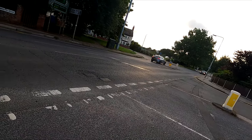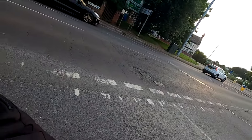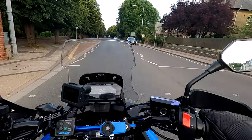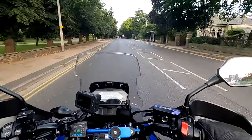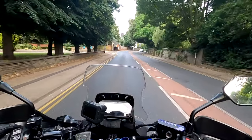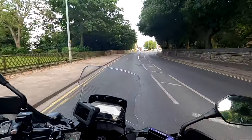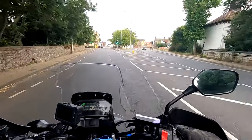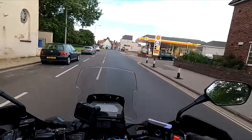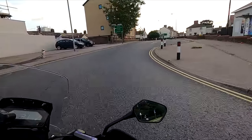Another thing a lot of people criticise are the stock tyres. To be honest the tyres are more than capable of taking on sensible day-to-day riding - if you're throwing it around the bends then these tyres are not great. But I've done 4,494 miles right now, I checked my tyres this morning and they're half worn with about four millimetres left on the front. I think I'll probably get about 8,000 miles out of these, and that's not bad - they've lasted a year. I don't have a problem with the stock tyres because I ride how the bike is meant to be ridden.